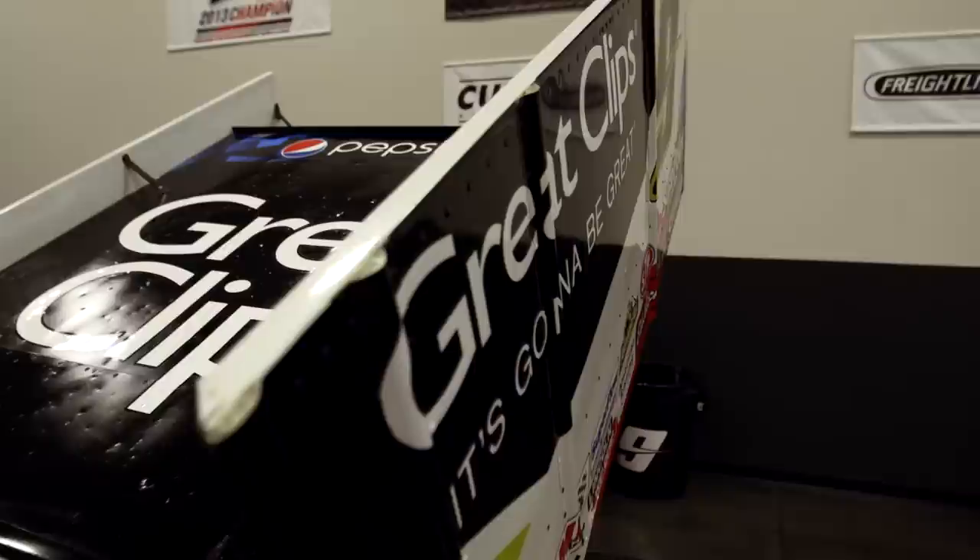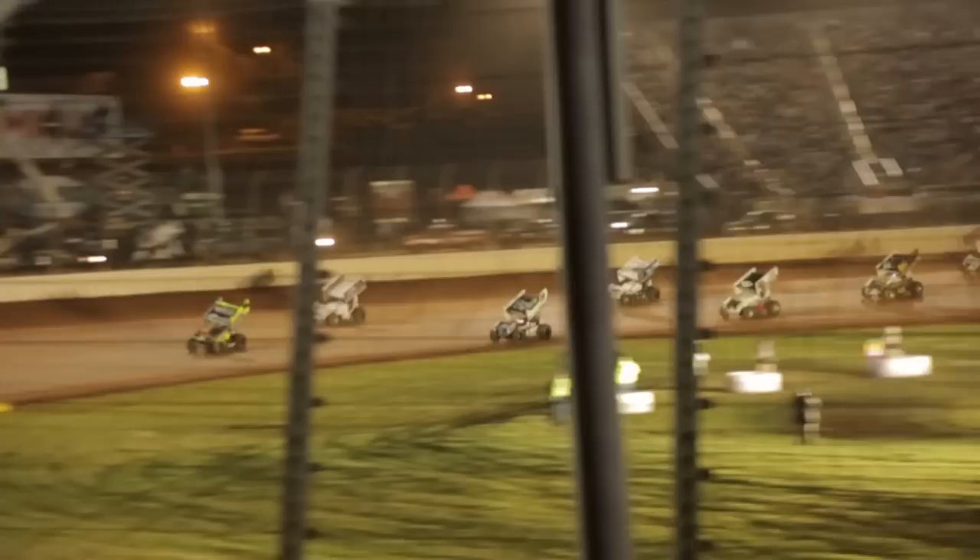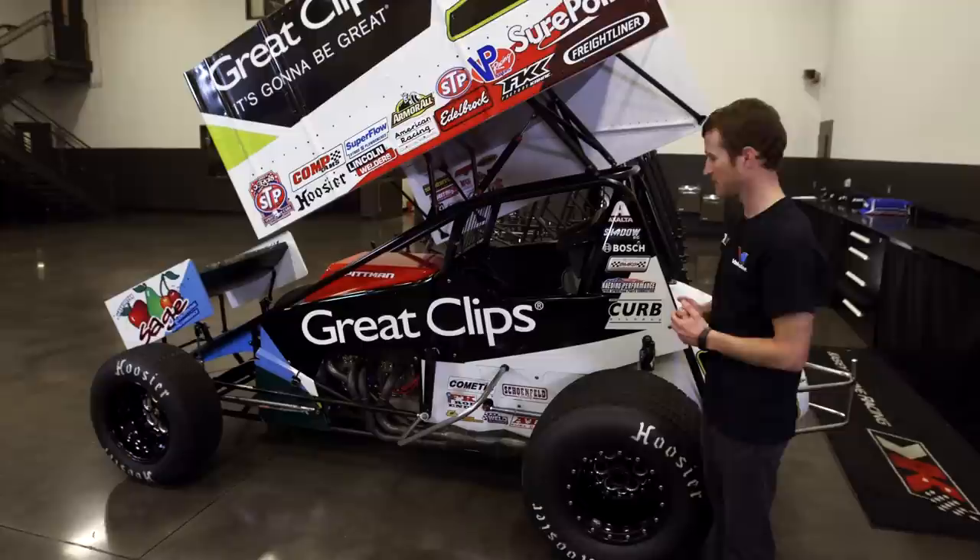First off, it's the top wing. It's 5x5 — kind of the first thing you see when you see a Sprint Car. Early in the night when the track's gripped up, the wing will start forward. As you lose grip and it gets harder and slicker, you start bringing the wing backwards and it puts more pressure on the rear tires for drive.